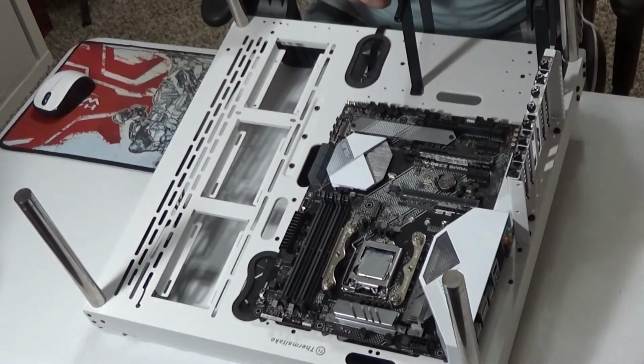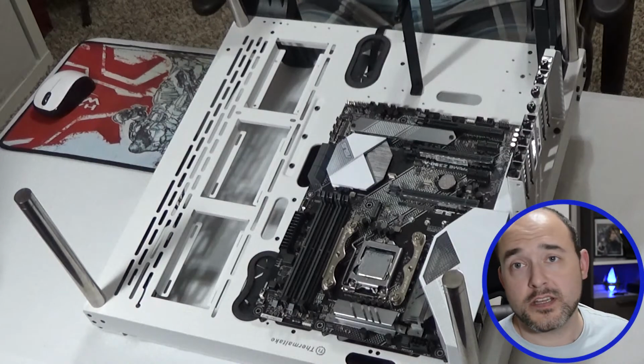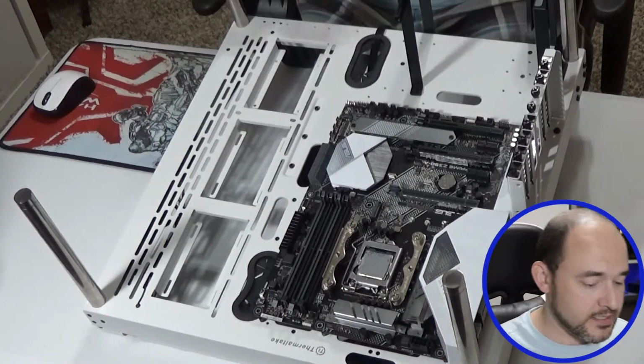Next step is gonna be making sure that the motherboard is attached to your case. So every motherboard or the case itself comes with screws that came also with the pins. So the little stands that this motherboard sits on, those little pegs, these screws are specifically meant for them. With these tiny screws comes a little bit of patience. You might drop them, might not. If you have a lightly magnetic screwdriver, you don't want a strong one, but a lightly magnetic screwdriver really helps.